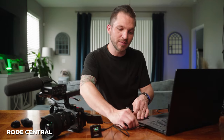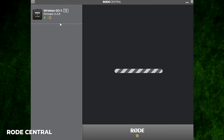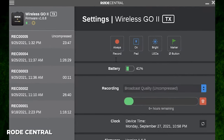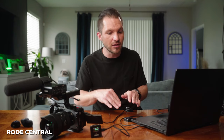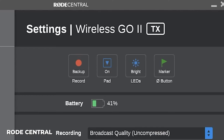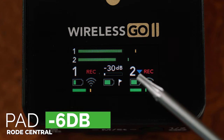To enable and access internal recordings, connect a transmitter to the computer via the Rode Central app. Select your transmitter, hit the gear icon, and find the recording tab. You can set it to always record — so it records whenever the transmitter is on regardless of receiver connection — or to backup recording mode, which only records when transmitter and receiver are linked. You can also disable recording entirely.